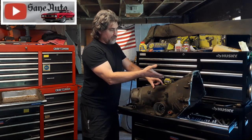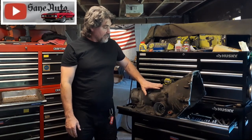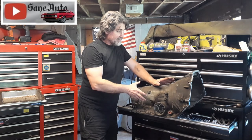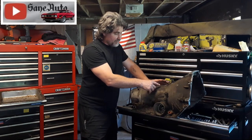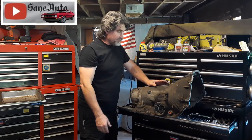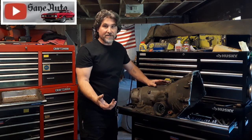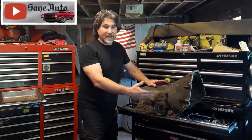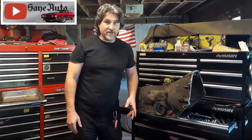So make sure you look all the way up to the top and start from the top down. Sometimes if it's really clean, it's harder to find the leak than if it's dirty, because when it's dirty it might make a clean spot where it's leaking and you can follow that clean spot up to where the fluid's coming out. I've seen a lot of guys very successfully use a puff of baby powder and look to see where it sticks — you can find the wet spot and see the wet trail. That works whether it's clean or dirty.